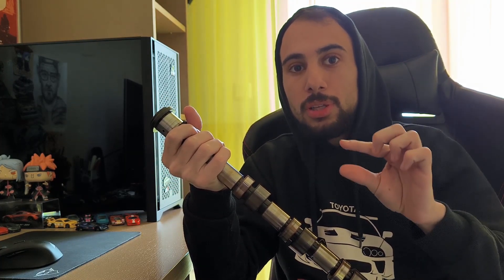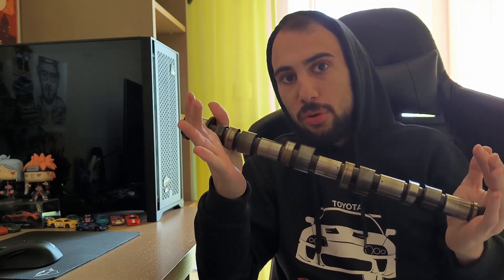Let's say you open the valve cover and you see the camshafts. Before we get into the camshafts, something I forgot to mention about preventing wiped cams: some people have added extra oil showers. They run an additional line — it's a tricky modification — having another non-OEM tube going around the camshafts with an extra shower that steals some pressure from the oil system and drops more oil on the head. Some people say they had great results.